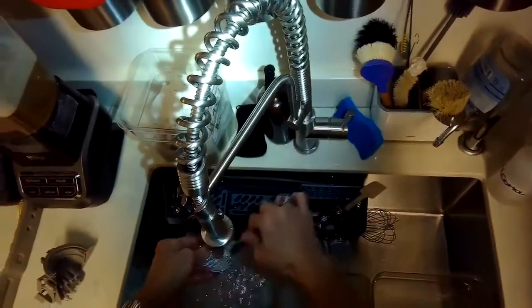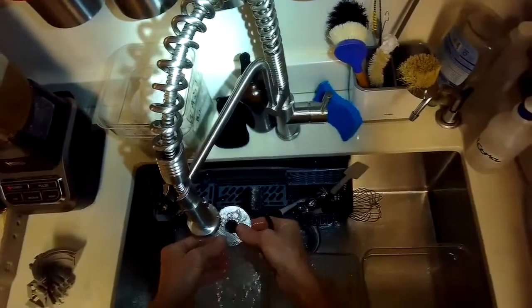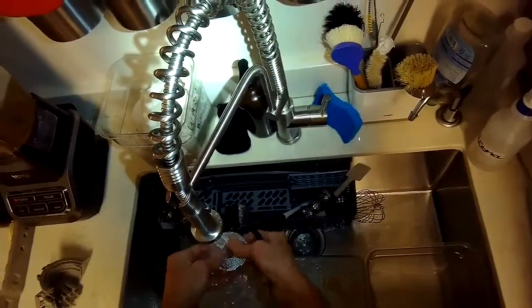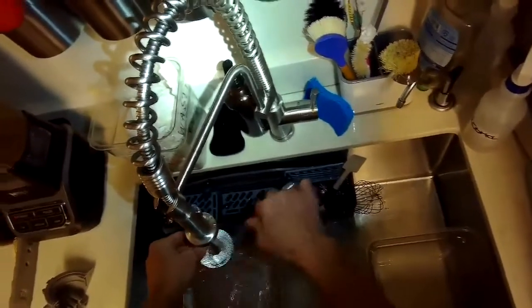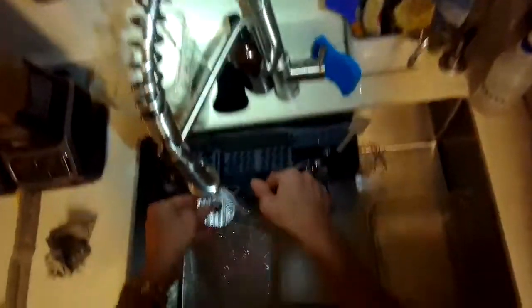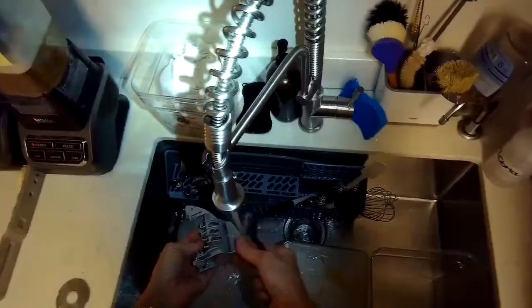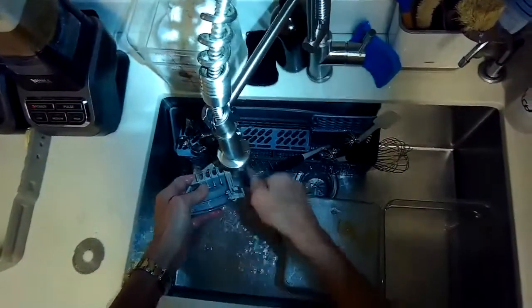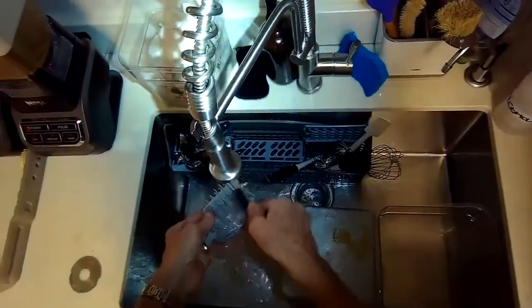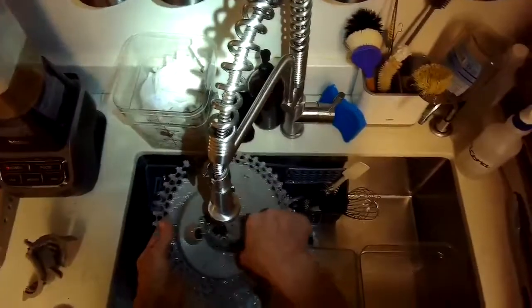This one is probably down about 80 percent from its potential. This applies to Whirlpool dishwashers — sometimes labeled under KitchenAid or Kenmore — it's pretty much the same innards, the same way of doing this procedure. We're going to clean this part they call the dam, which helps catch some of the big things that might try to clog up your system. Just run this under hot water to get everything super clean.